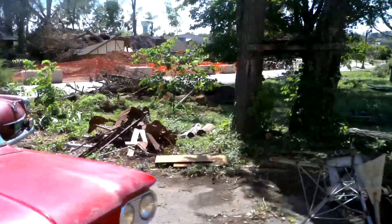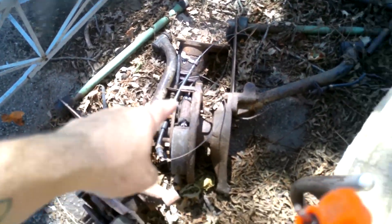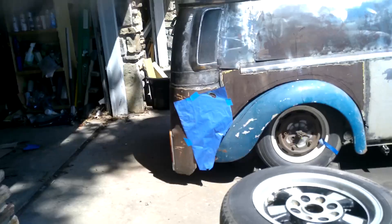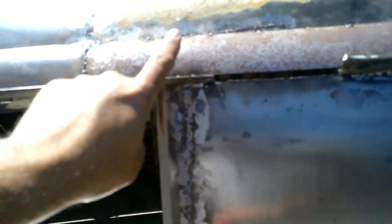I'm going to convert it to IRS. I've actually got the arms from the '71 bus that I chopped up — a tornado took out the windmill, had to move it. Then I will convert this pan to handle IRS. I'll reinforce the A-pillar here to do the new door hinge delete. The more I think about it, I've seen a lot of cars keep this, so I might just keep this and just knock it off here because the rest of it doesn't need it. I'm just going to get rid of the back section and the gutter back there.